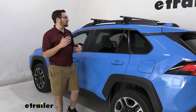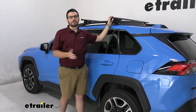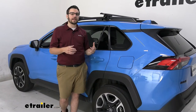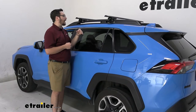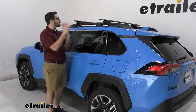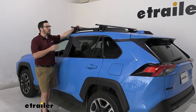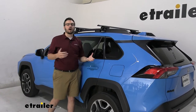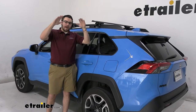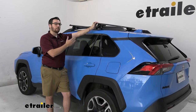A couple of things with this, though. I have seen just a few reviews noting it's not the strongest roof rack system out there, and with a 150-pound weight capacity, it's not hard to imagine that — it's not quite up to par with the standard. Usually when you're looking at roof rack systems, you're looking at about 165 pounds of weight capacity, so you are already a little lower than most out there. I don't think it has an H-bar support system throughout the entire piece, so I'd be careful putting too much weight, especially in the middle. I would heavily utilize these side towers, making sure most of the weight is on the sides of the vehicle.